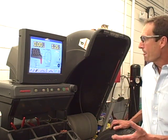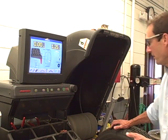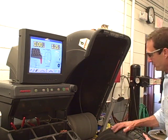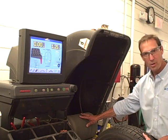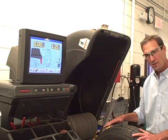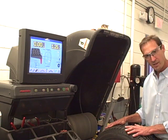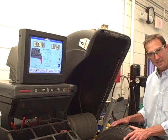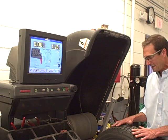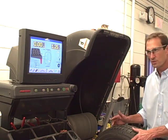Today I'm going to show you matching the tire to the rim. This balancer has a wheel that puts approximately 1500 pounds of force against the tire to measure possibly inconsistencies with rim, tire, maybe a high spot or a low spot or tread difference or some irregularity with the tire that might account for it to not be rolling as smooth.